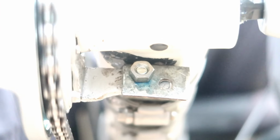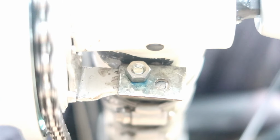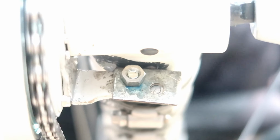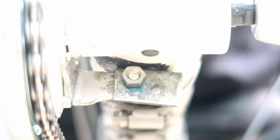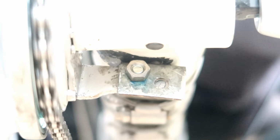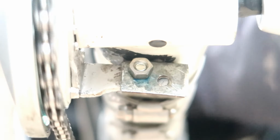What I have got is a short bit of video with the trike on the stand, with me pushing to the equivalent of the highest gear I've got, so going up a tremendous hill, putting quite a bit of force through the gearbox, and there's movement there, but what I think is there now is not movement of the gearbox, I think it's movement of the boom. You can tell me what you think, but I think it's the boom that's moving more than the gearbox now.